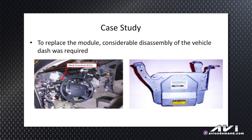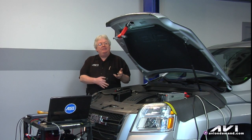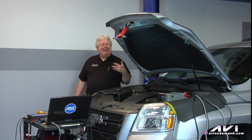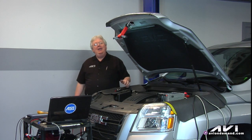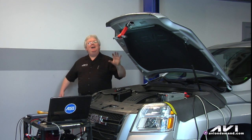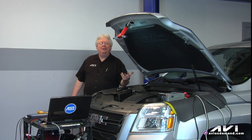There's a picture of the part and the R&R to get to it. We ordered it and it came in two days. We put it in and had to use the factory tool to do the vehicle stability control resets for the yaw sensor and this module. There were some resets and learns that had to be done, but after that was all completed, the codes cleared out. The Prius was back on the road — my wife had her little Prius back and was happy after yours truly took about a month of Sundays working on it.